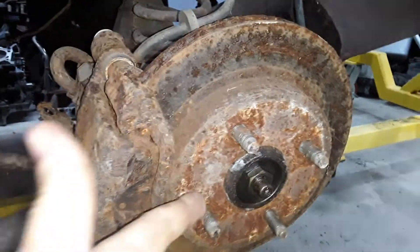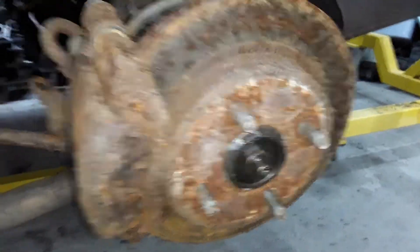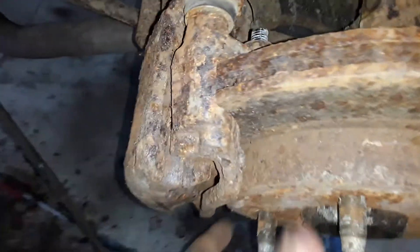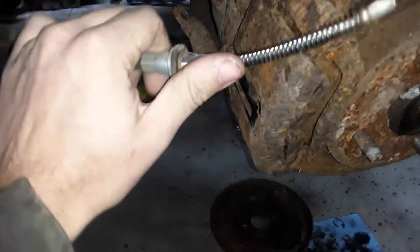You could put a spacer behind the hub on the backside of the rotor, but I see no benefit of doing that other than it would allow you to use a thicker plate between that spindle plate and our mounting bracket. The parking brake cable will still work — it will go just back here instead of on the bottom of the drum. And because of its relocation, you just have to push the cable back some. You can see this is actually the stock Escort EXP cable, and I have a little bit of excess length, so I'll see what I have to do about that.